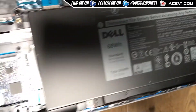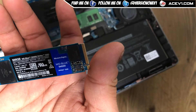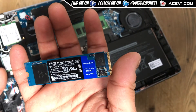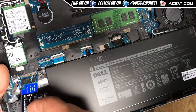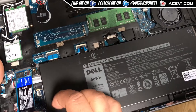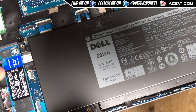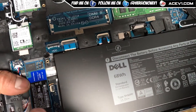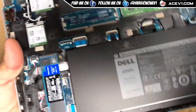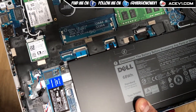Looking at this, you can actually install a full-size SSD. I've got a WD Blue here — a standard full-size NVMe SSD, literally about 40 pounds, so not too expensive. You just install it right there and screw it in place — no need for that stupid plastic adapter or memory module. Then you can stick in a USB or external drive, install Windows, and you're done.